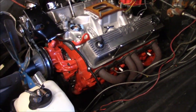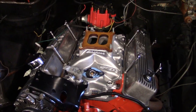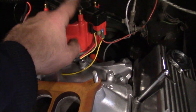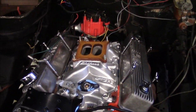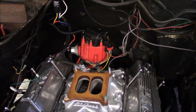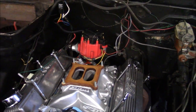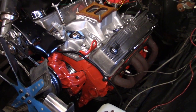This happens when there's no spark plug wires on it. A lot of people just look up on the internet, bring up a picture on Google Images or look at a service manual, and they're like, oh, this is number one cylinder because the book says so. Well, the problem is, if the distributor's ever been out before, you can make any post on the distributor number one cylinder. It doesn't matter — the engine will run either way. It doesn't even run any different. As long as it's still timed properly, it doesn't matter where you put your number one cylinder.